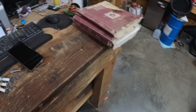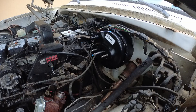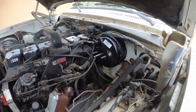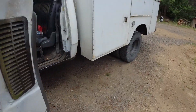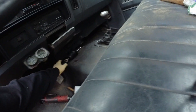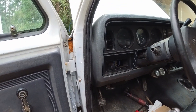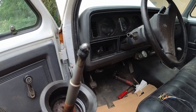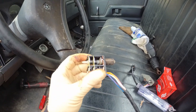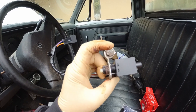Back to the first gen — what I was able to determine is the booster has this rod that connects to the pedal. On the end there's a little retainer that holds the rod in. That retainer went bad, which allowed the rod to pop out, which allowed the pedal to go up too high, which in turn messed up the switch, which is what bent the bracket, which turned the brake lights on all the time.